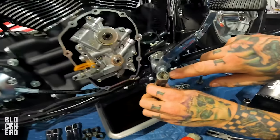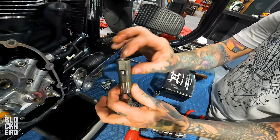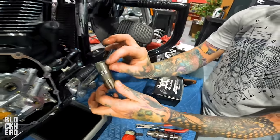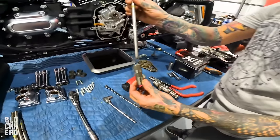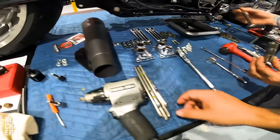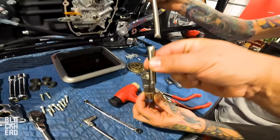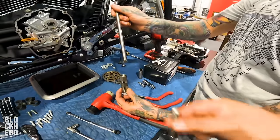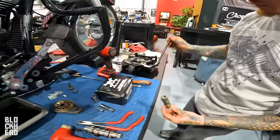And there is a piston in here. It's a hydraulic piston. Once this is compressed a certain amount, it has a squish factor on both ends. In essence, this pushes on this. Of course, it's not going to be cut; it'd have a nice round end. It'll push on the ball end like that. So that rides on that, that is connected in between, and that in turn hits the rocker arm.